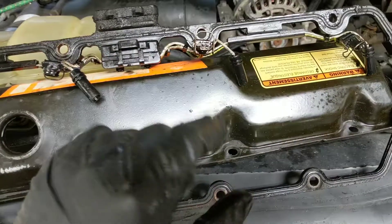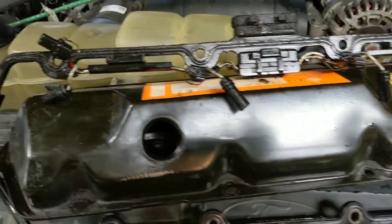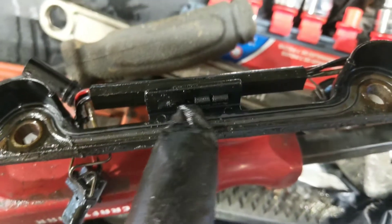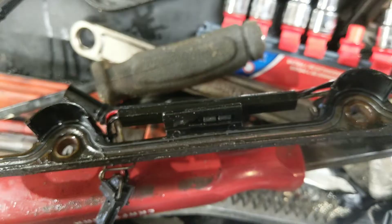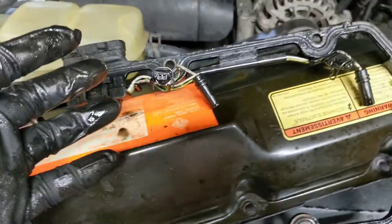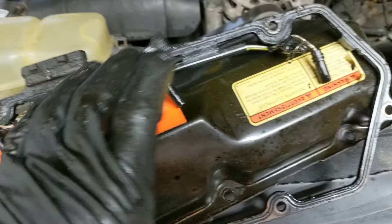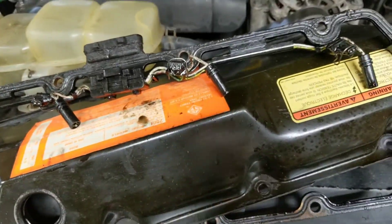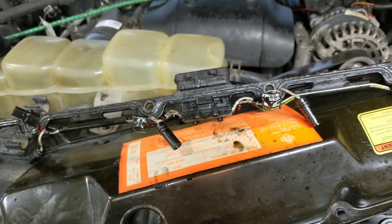When you remove these, there's a clip that holds the wires inside the compartment. They're a pressed-in style clip, and one actually broke off while I was working with it. These little plastic pieces want to fall down inside — you just have to fish them out. If you can get this off in one piece without disconnecting the wiring harness you should, but if you have to disconnect it, remember these can fall apart. If you reuse the valve cover gasket, those clips aren't going to work well either — I recommend you replace them, as they're prone to fail over the life of the engine.